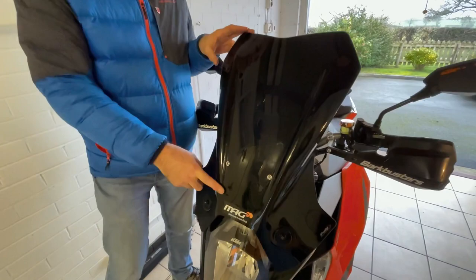There's also side-to-side movement, and that helps dampen any vibration coming up from the yoke into the handlebar. That really did make a difference for me — some people obviously don't have this issue but unfortunately I did. It was around the £200 mark, which is a lot of money, but if you're contemplating potentially selling the bike because you can't live with the vibration, it's definitely worth doing. It also lifts the handlebar up by about 50mm, and I've also brought the bars slightly further towards me, which again helped comfort.